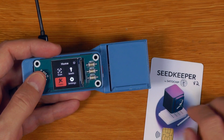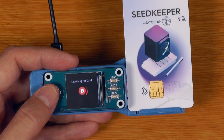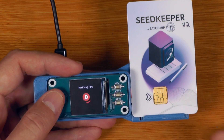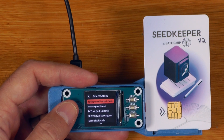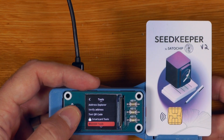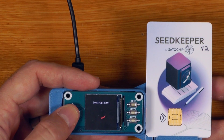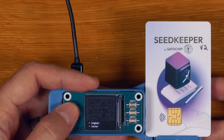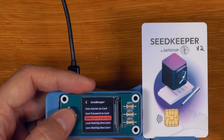Here I have an updated version of my SeedKeeper plus SeedSigner fork. If we put in the version 2 card we can load the seed from the SeedKeeper card just like before — I'll set the PIN to 1-2-3-4 — and there are all the seeds on the v2 card copied from the v1. We can also go into smart card tools, SeedKeeper functions, and view secrets on the card, like loading a demo password to see it on screen. We can also show it as a QR code to scan with another device, and we can now delete secrets from the card, making this much more useful as a general password manager.